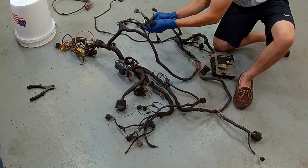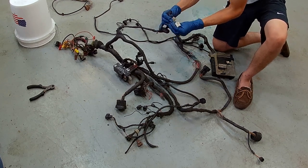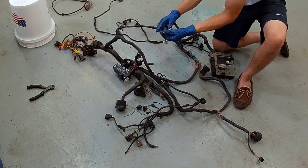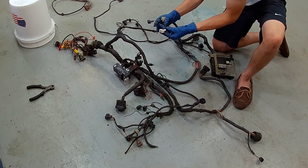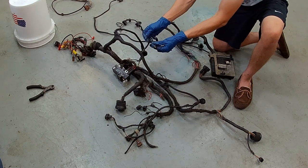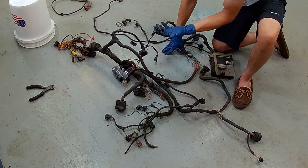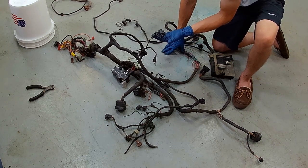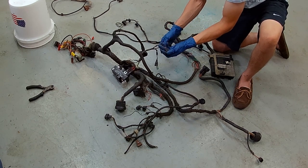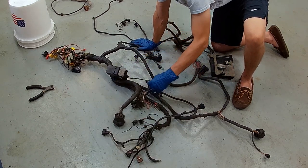So, you're going to have the wiper plug, the ambient temp sensor that goes up under the rain tray, and then this should be for the alarm horn, if I'm not mistaken. That we're not really going to worry about too much. Then we have our brake switch, which you can tell this was in a Mark II and it was leaking, but it was modified. Solenoid for your recirculation flap, which is vacuum controlled in a Mk3, and of course the coolant bottle, which looks like it had corrosion on one of the pins also, so that's cool. Fan control module, that's still here, so that's no big deal.